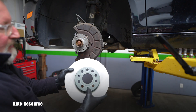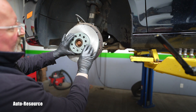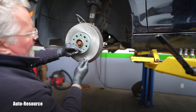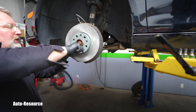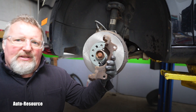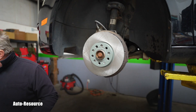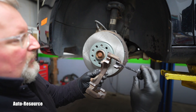Here is the new rotor. There is that space for the small bolt which just holds it on the hub and prevents it from falling off. I will apply anti-seize on that mini bolt. Then I will carefully put it in place — the repair manual says it's only 4 Newton meters, so don't crank on that too much. Before installing the brake carrier back, I will apply high temperature brake caliper grease on the channels where the brake pads will be traveling — it's easier to do it now instead of next to the rotor.